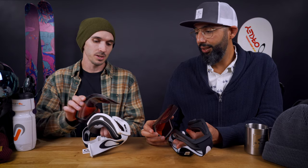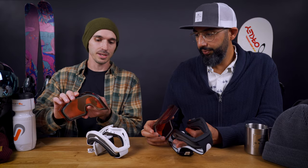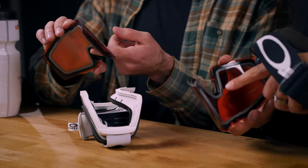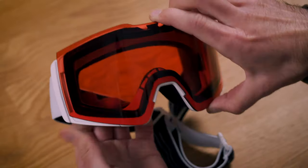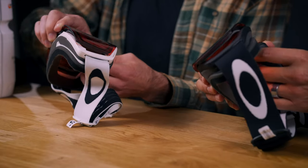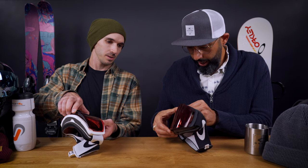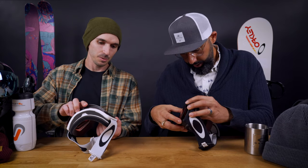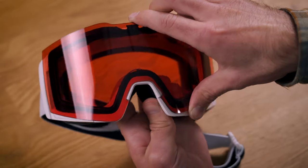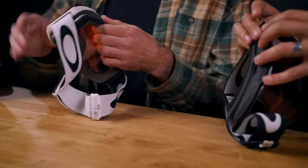Putting it back in, you're going to just reverse the process. Start around the nose bridge at the top — it kind of has these little notches here. Make sure that center one is aligned with the tack of the nose bridge — there's a hole right there. Fits in perfectly. Once that snaps into place you'll feel it, you'll know it's there. Then you kind of walk down each side of the nose bridge, making sure the space in between is filled in with this first layer of plastic. Line that up on the bottom, then work your way around the outsides.